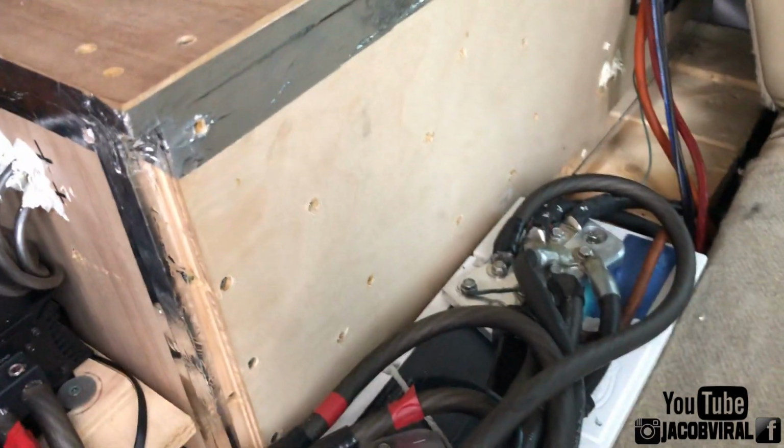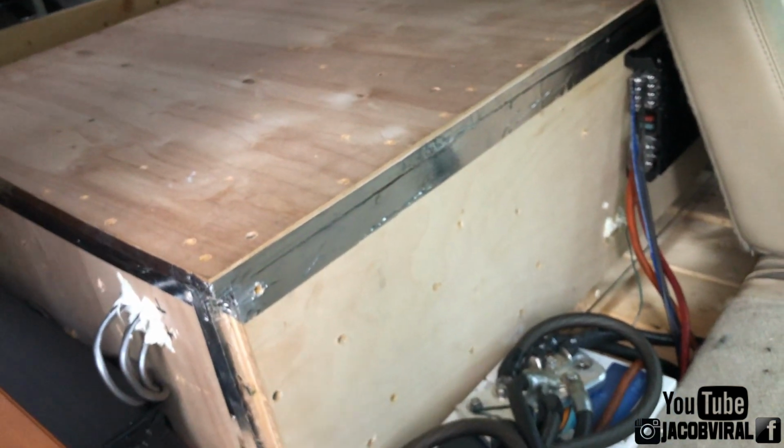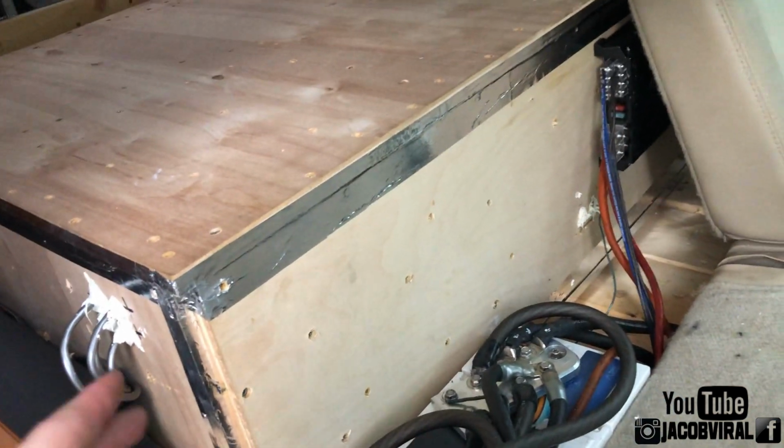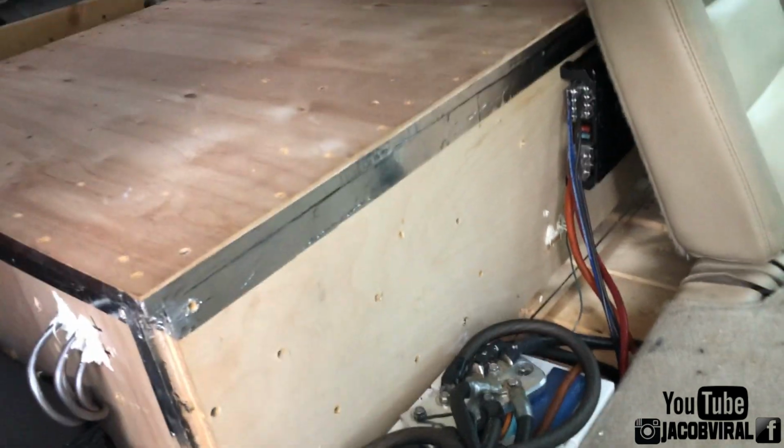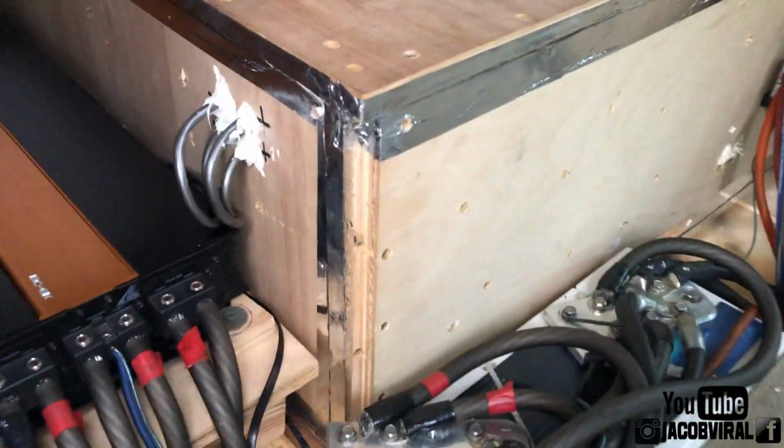The alternator is only going to support so much, and I feel like the batteries outweigh the alternators. But it depends on how big you're going. Big guys that are big into audio, back when I had around 20,000 watts clamped, I literally had around 700 to 800 amp hours of battery plus 2 alternators, and of course I had lithium before that, which is another whole topic I'm not going to get into.